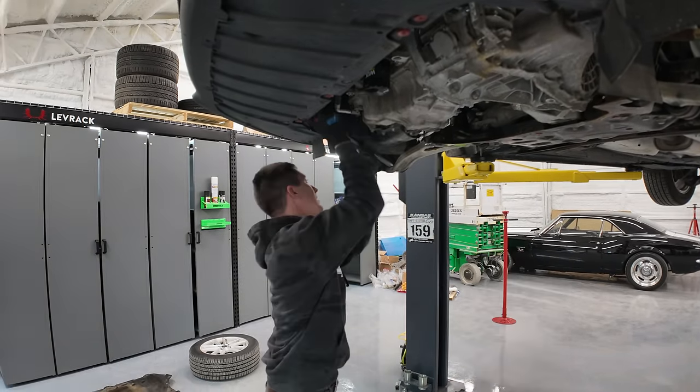Now we're ready to bust these nuts or bolts off right there. That pulls off these big spring-loaded hold downs, and then we can pull those bolts and actually get out what the clutch actuator drives in, which is this unit right here. So the motor turns a little spline shaft and it just runs in and out real quick. And that's what pushes on these forks.